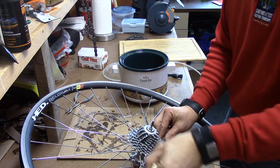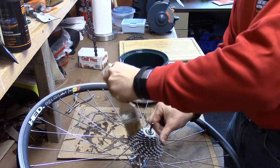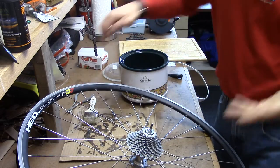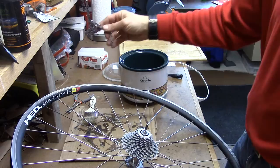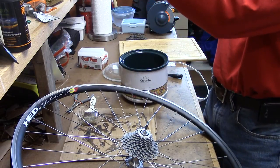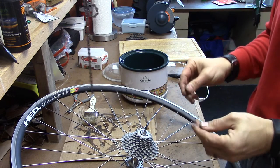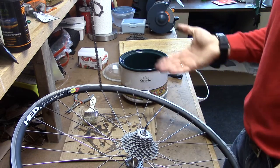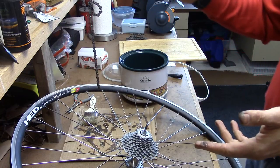You don't have to clean it off — that's one of the wonders of this. Just as soon as you put the chain on and start running it, it'll be a little ratchety at first because of all the gunk in the way. The chain itself when it finishes drying will be stiff and difficult to work, but once you get on the bike and spin it a few times the excess paraffin will come off.